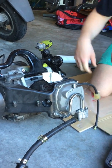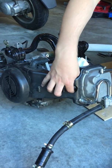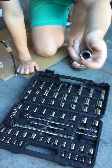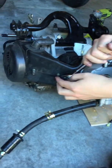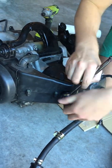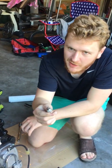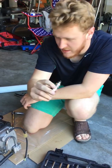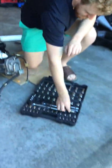We're going to start with the first step: take out the spark plug. The spark plug is always going to be on the exhaust side of the engine, the stator side, and this is the same in all GY6 engines. Use a spark plug socket, attach it on, and go real gentle with it. As an aside, the condition of your spark plug can give you a lot of information about what's going on in the engine. This one is a nice caramel color with a little bit of black soot on the edge — that's because I run mine a little bit rich. Put your spark plug somewhere you can find it.